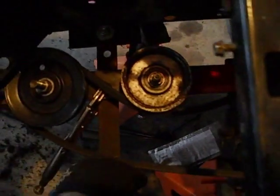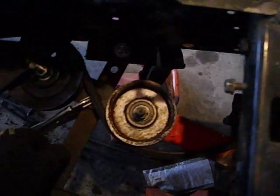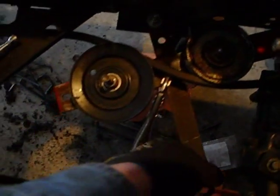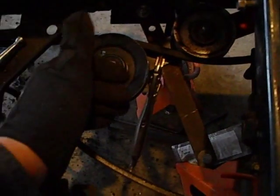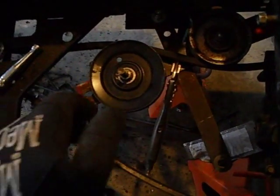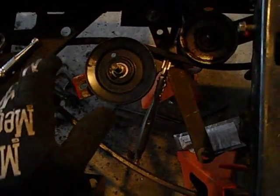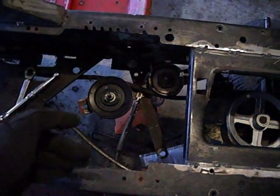Let's get the belt around the back. This is with the clutch out — you can see it has a nice tension, the belt goes all the way around the back pulley and all the way around this one. If you clutch in, I don't know how I'm going to link this up yet because it's a lot of travel. This is as far as it goes right now with the end piece not cut off, and it's pretty straight back to the back pulley. If I shorten this up or cut a triangle out of it, I'd have more room to go back and a lot less slack — it'd be straight all the way around. I'd need good belt retainers, but a nice tense clutch is going to make this thing fly. I've got to figure something out about that and weld it up — it's just vice-gripped on there.